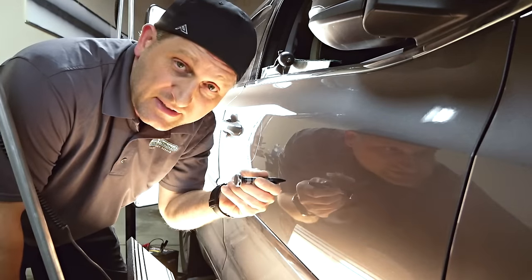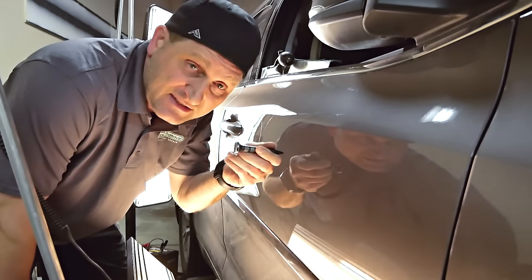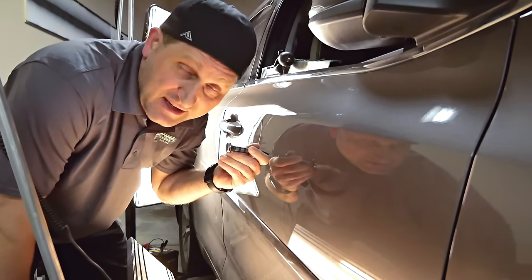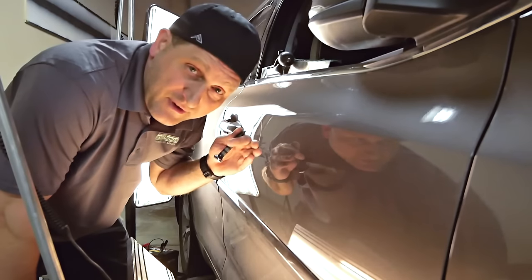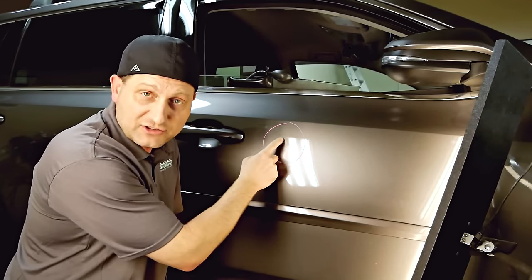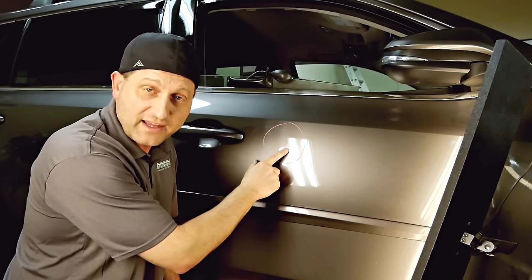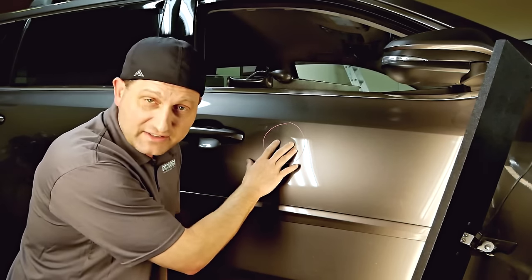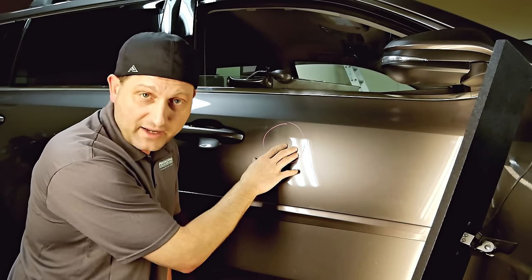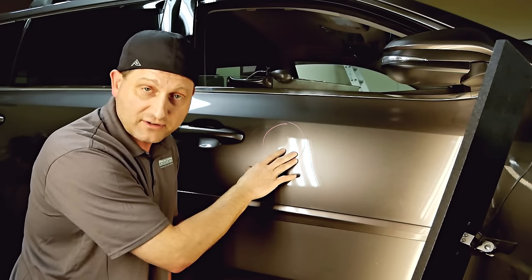You can see when I'm doing the tapping it's almost the same process as pushing from the inside — not a big, hard hit, just a very light pushing down of those spots. If you look really close in the light with strong detail, you can almost see the vibration of the panel, and that vibration actually moves the metal too. I'm going to go in with the softer tool at the bottom, then a sharper tool right in the center of the deepest part of the damage to finish it off. You can barely see the remaining detail on camera — it's such a fine amount — but I can see it with my lights and eyes. I'll work on it a little bit more and then show you the final result.